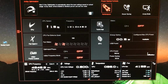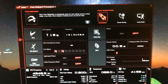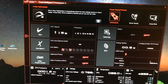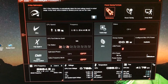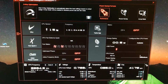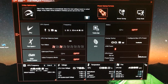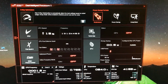Okay, the same test under all cores together instead of per core was much worse. It did overclock to 19%, and then at one point it was at 23%, but I don't know what settings it was exactly changing, but they weren't stable enough and the computer had problems. So at the end of the day, it came to a conclusion of 15%, so definitely if you're going to use this, the per core option is better.